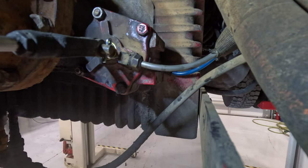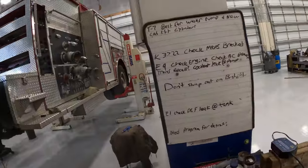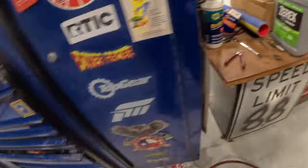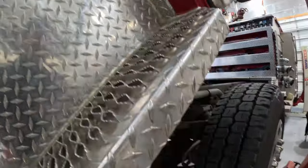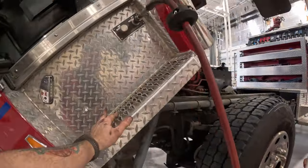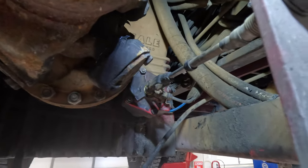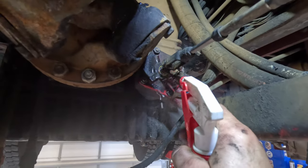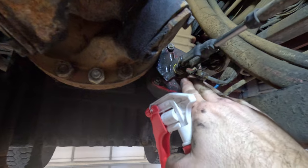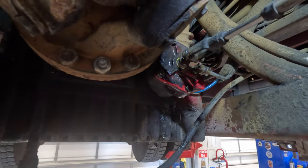Let's test it out — build some air pressure, see what we got. Now we have 120 PSI on our air tanks and we'll spray it with some soapy water. Before, our air leak was coming around the shaft seal. No more leaks. That's how you do a VPS kit.